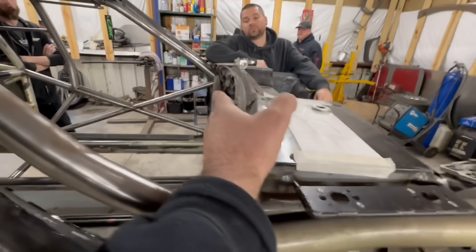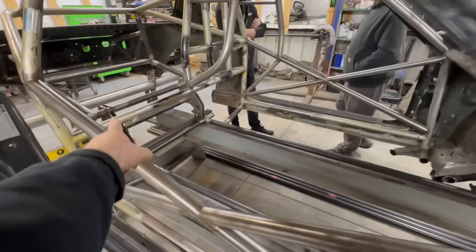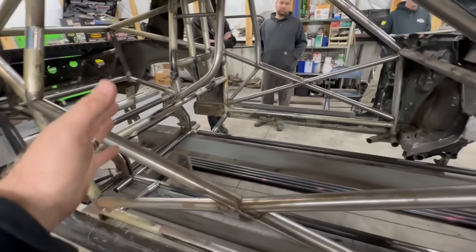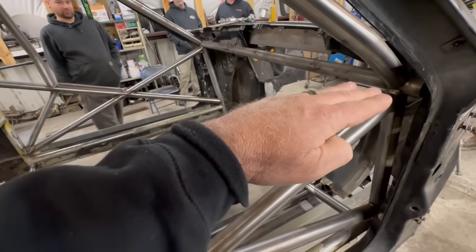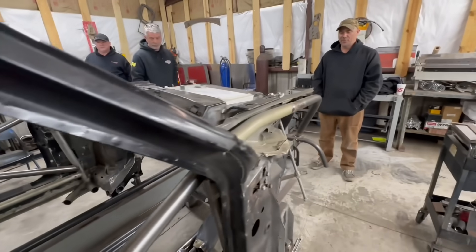This is 75 inches. What we're talking about - 75 inches is from the mid plate to the rear end housing. The shorter that distance is, the easier it is to pick up. Think about weight on a board: if you've got a thousand pounds that is 90 inches out, it's harder to pick up versus if it's 70 inches out, it picks up easier. It's leverage.